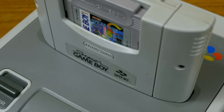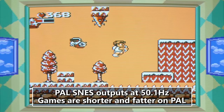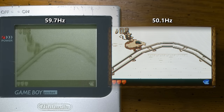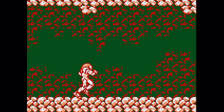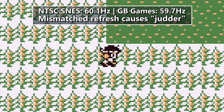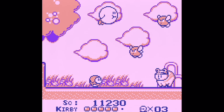When playing on a PAL region Super Game Boy, games run at the same speed as they would on an NTSC Super Game Boy, but the output refresh is synced up to the typical PAL 50Hz. Game Boys from all regions run at about 59.7Hz, and the old LCD screens have so much motion blur that even the lower 50Hz on a PAL CRT could be considered an upgrade. A consequence of trying to make these games work on an NTSC or PAL video system is what people call judder — sometimes you might see a slight frame hitch that wouldn't have happened on a Game Boy LCD screen. Most of the time this will probably go unnoticed, but if the screen is scrolling in one direction for a while, you might catch it.